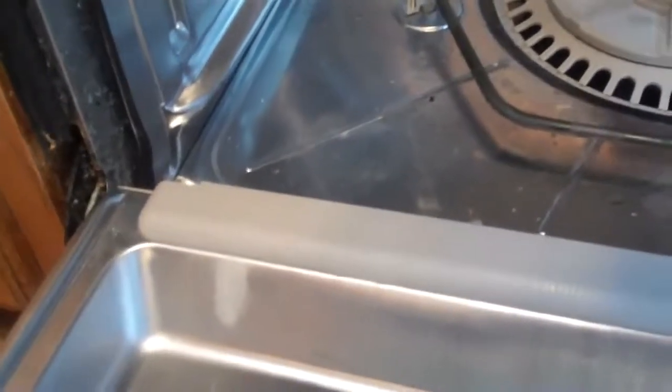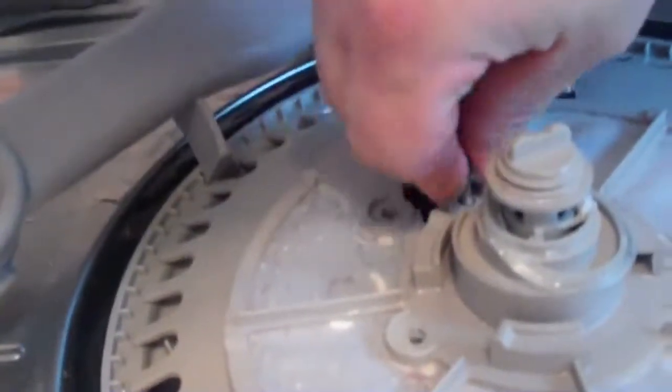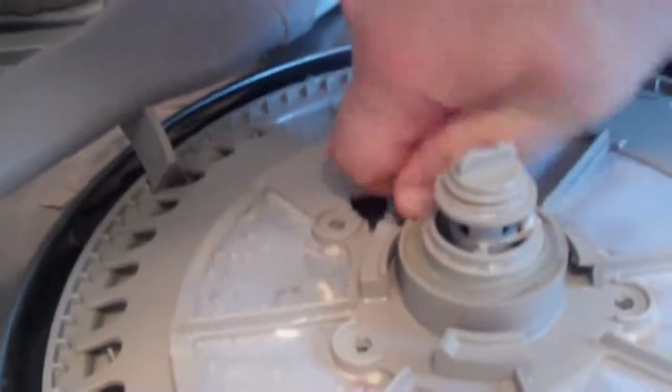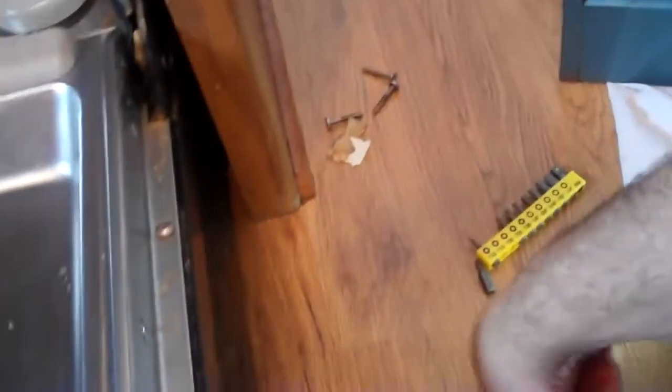When you put it back together it's actually gonna work. That fits right in there like that — this gets a quarter turn to get it seated. Next you need this part, but before you put it in place remember to put the one screw that will be obstructed back in place first. If the assembly is in the right spot it'll seat up and you'll be able to screw it in. I recommend a couple of hand twists to make sure it's started, then drill it in. Remember to switch back to your T20 bit.